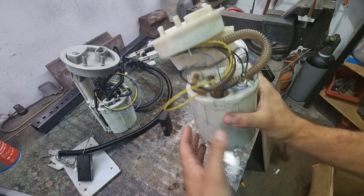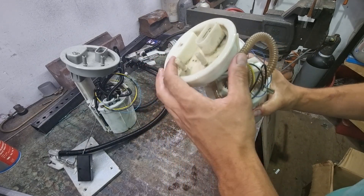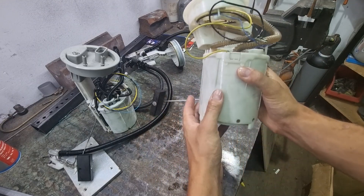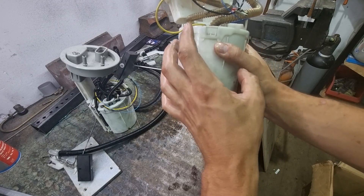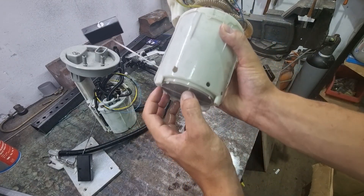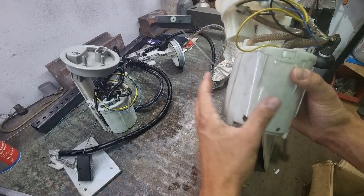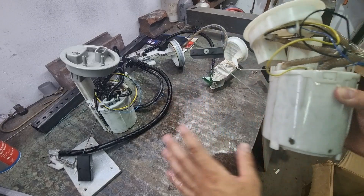This pump is specific — I don't know which engine it's from exactly — but this pump doesn't have fuel pressure at all. Its only job is to put all fuel from the left portion of the tank into the right tank, and the housing is always full of diesel. The pump suction is from the lower portion, and it transmits fuel from the left portion to the right via an ejector.